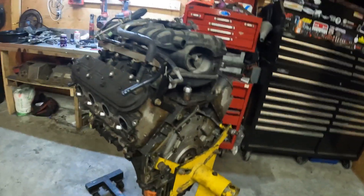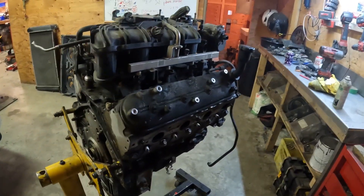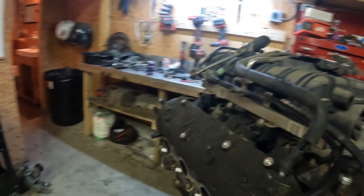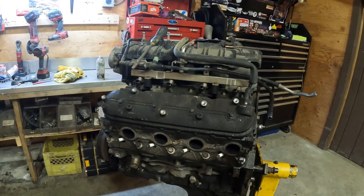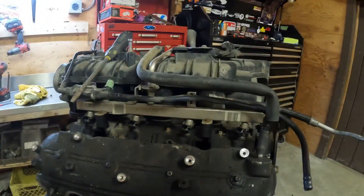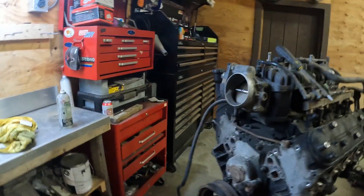I did get it running in the car pretty well. It wasn't running off one bank because one of the power wires coming into the coil pack on bank one was completely eaten through. That was pretty nice to find out after I bought it - but it wasn't a big deal. We'll see what happens when we get a look inside the engine, but I got it running and it runs good. Just kind of started pulling all the accessories off.